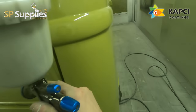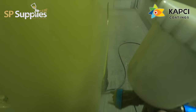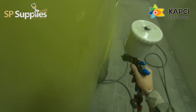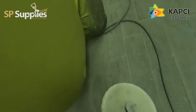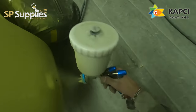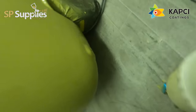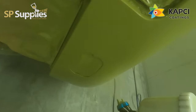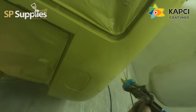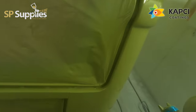At the moment the Caprice is going to get super build on that - so it's already been boxed and blocked, all repair work has been done. I'm going to super build it, block it again, then it's going to get primer. After that, if everything looks straight, we're going to block it again with the DA and then into paint. So every panel has probably been blocked like four or five times by the time it's been finished - it's crazy to think about just how many times.